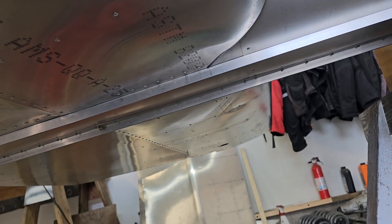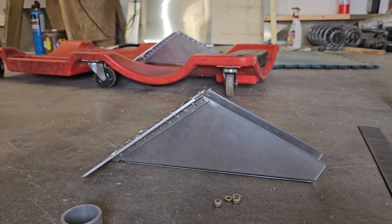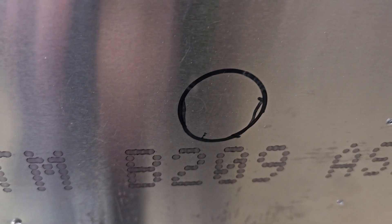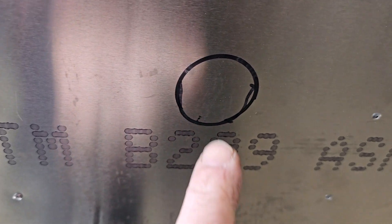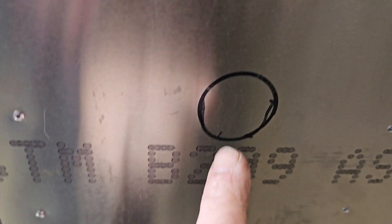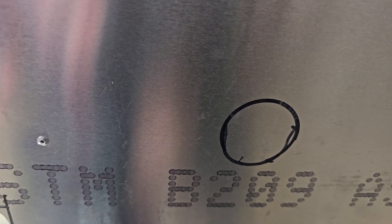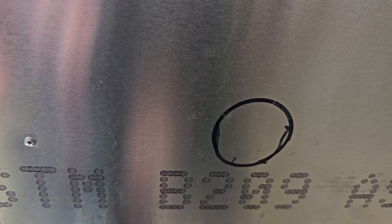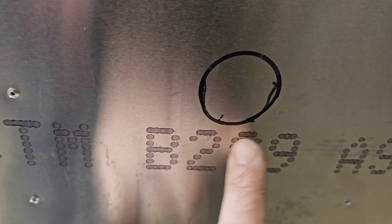Under the wing here — I've marked the spot where the gear leg needs to go through. Cut the hole on the other side basically by putting it up there and marking where it was, then used a short little piece of tubing to finish the circle. I'll drill up through there with a step drill, get it close, then finish it out with the burr. Need to make a little notch on the side to clear the piece of tubing welded to the top of the gear leg — one notch is all you need. Slide one side of the tube through, spin it, slide the other tube through. Put the notch on the back side where it's not very noticeable — it's covered by the plate.